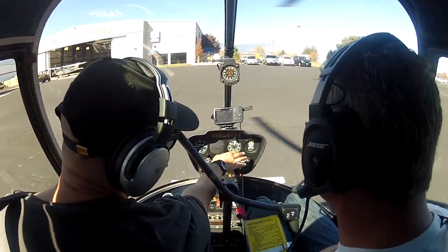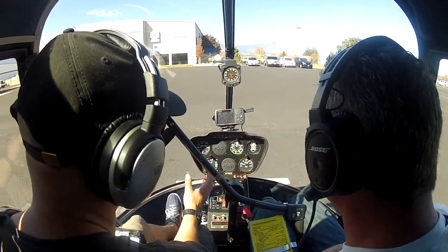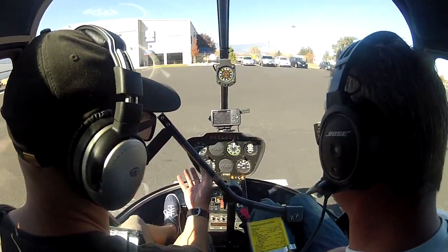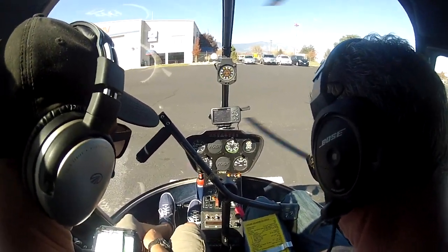And you're going to see your RPM start coming up. You were at 75, now you're at 80. So that's a direct correlation there. You're putting cooler air into your engine, so you're getting better horsepower. It's bringing up the RPM a little bit. Cool. Carb check, check.